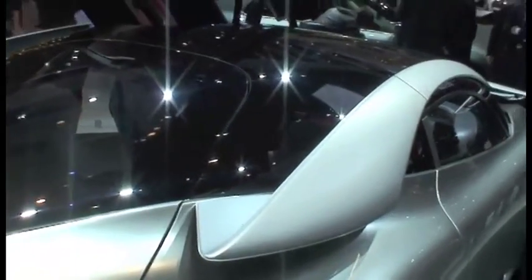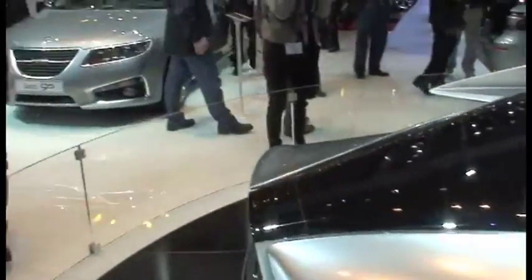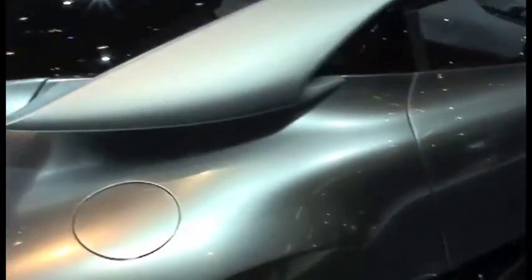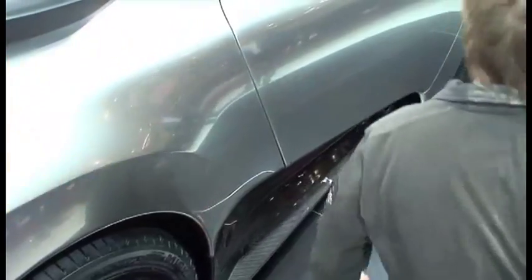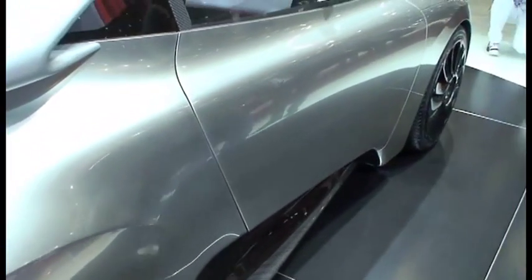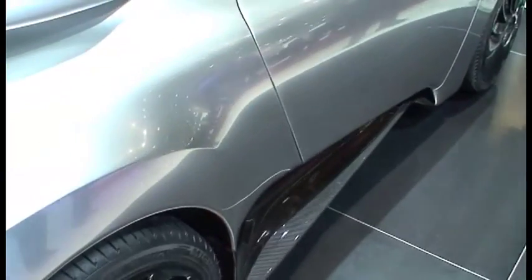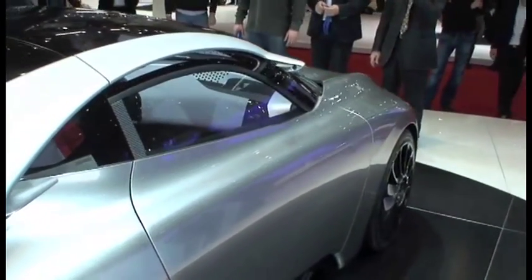They have been the most controversial aspect, but we expected that. They do actually serve a very important aerodynamic purpose. And even the body side — when you look at the lower area of the rocker behind the front wheel — that's a pressure release zone. What you have there is an open area. This is something you see frequently on Le Mans cars. There's a lot of turbulent air that builds up in the wheel well. That allows the air to escape, allows more air to remain attached to the side of the car, which keeps drag low because the velocity of the air moving across the car is faster.